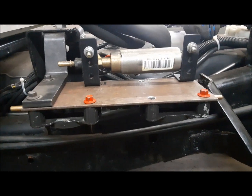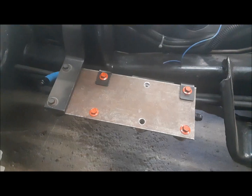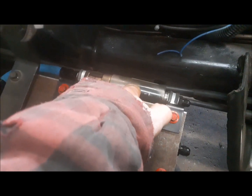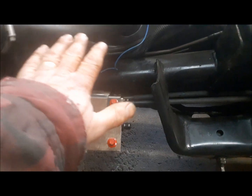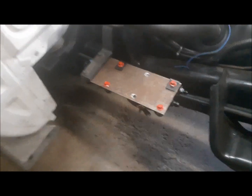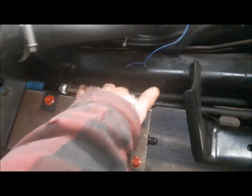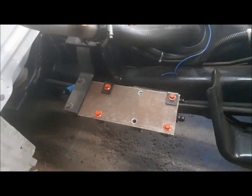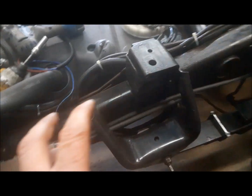There's our pump mounted. Now we'll start getting fittings and lines and stuff sorted out. I moved the pump — I had it sitting up on top of the bracket, I've got it down there now. I put the fuel filter in kind of where I figured it would be in the three dimensions of space, and the fuel pump may have interfered with it and rubbed on it. It's actually better down there, because when I take the filters off, it'll keep a prime in it because it's below the level of the filter heads. I've got my first line put on, so we're going to start building up the lines now.